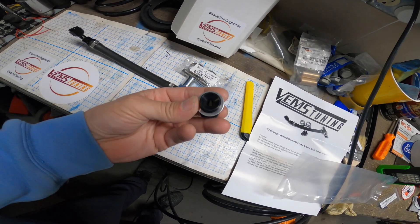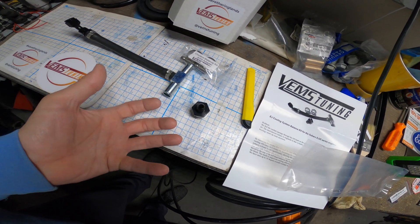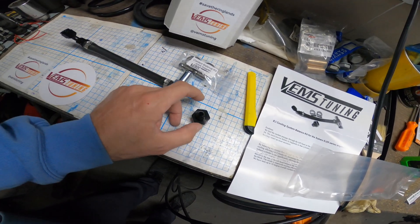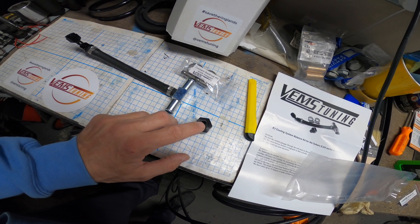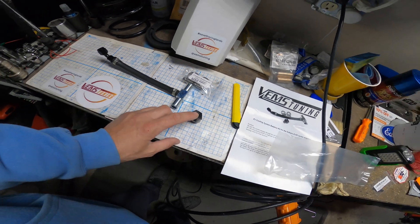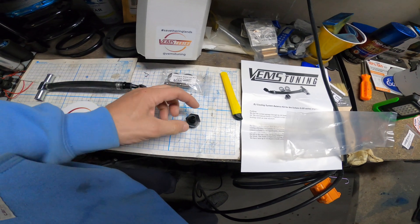The fitting that goes into the head is 26 millimeters, has a crush washer, and does not use RTV sealant. You can use a little bit of thread sealant, but it threads in so well that you don't have to. Where all the kits differ the most for me is flow — each one has different characteristics for hose inner diameters and the nipple's ability to flow versus the 45-degree angle it has to pass on the VEMS kit.